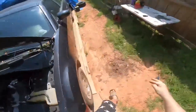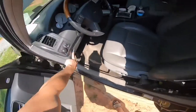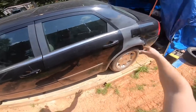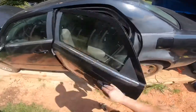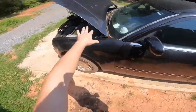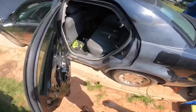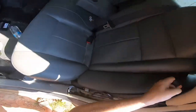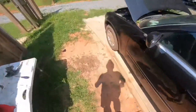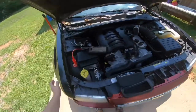We're not getting any chimes, which is not good. So you need some kind of battery source to get any juice so you can go to the trunk. In this case, if you can't open the trunk or start the car, you need to open up the rear seat by pulling this tab here, climb inside, and pull the little green lever. It's a glow-in-the-dark pull lever. So I hope this really helps somebody.